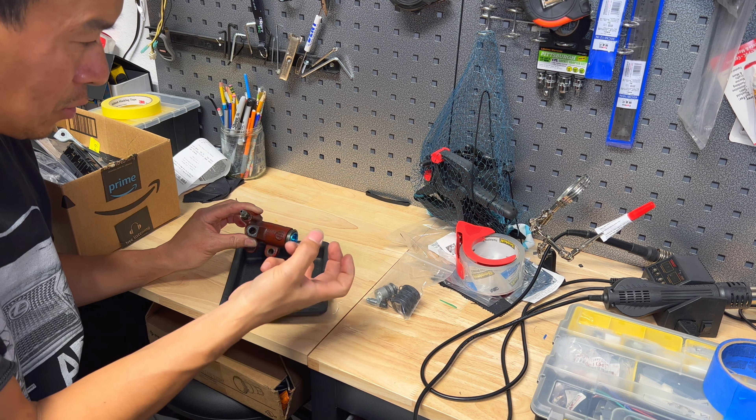We'll go ahead and put this thing back together. I went ahead and primed it with some filler primer and I'm going to let it dry for about 10-15 minutes, then coat it with some perfect match. We put two layers of perfect match graphite gray pearl, and this baby is nice and clean now — look at how smooth and good looking that thing is. Go ahead and let this dry for a couple hours, maybe a day or so before putting it all back together.